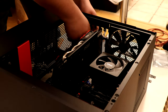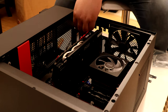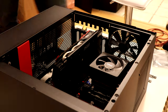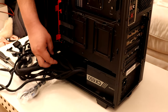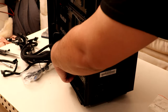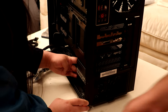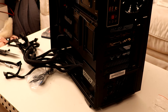Since I also have a PCIe capture card, I'll do the same thing and screw it in as well — note that the screws were a pain to unscrew without the proper screwdriver head, just a heads up. We're practically almost done. Now we add the power supply — grab the screws that came in the case and screw in the PSU at the bottom of the case. The fan should be facing the ventilation hole, so the fan on top of the PSU faces down if the hole is at the bottom. It may look upside down but you must ensure the PSU has enough airflow.